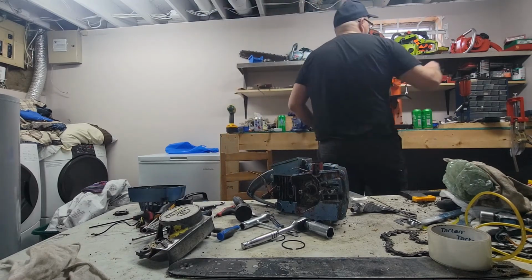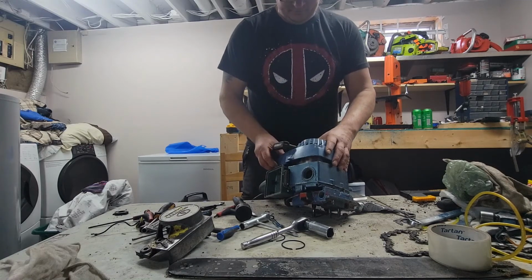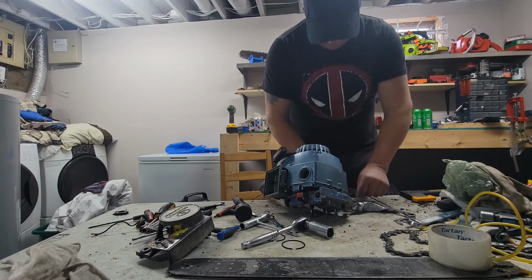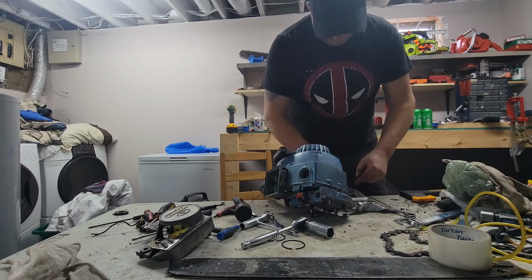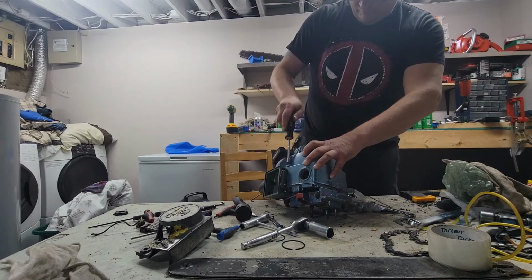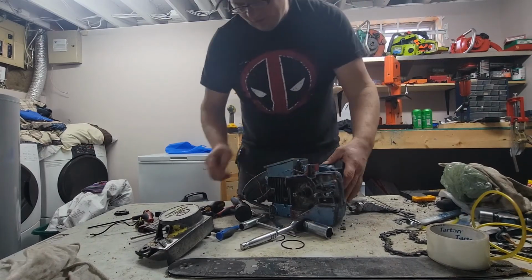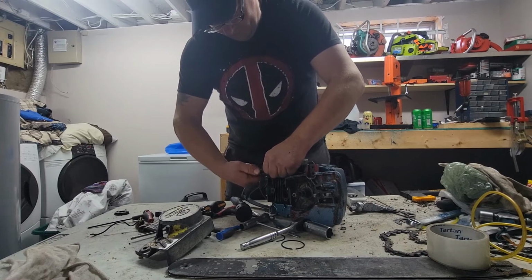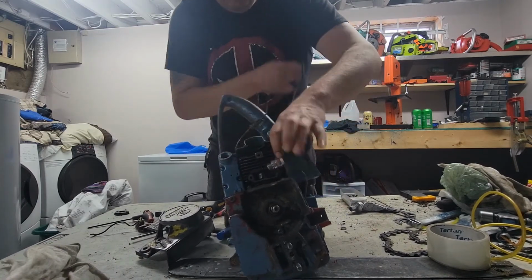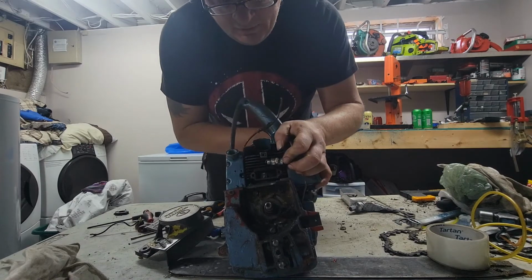Either way, I can go back. It's much more suitable. Get this recoil on, make sure it's not sparked. Screw in for now. Okay, let's see if this baby will spark. There's no kill switch hooked up currently, so. Yep, it's got the spark. Ground out through me there for a second. Let's turn the spark plug that way so you guys can see.